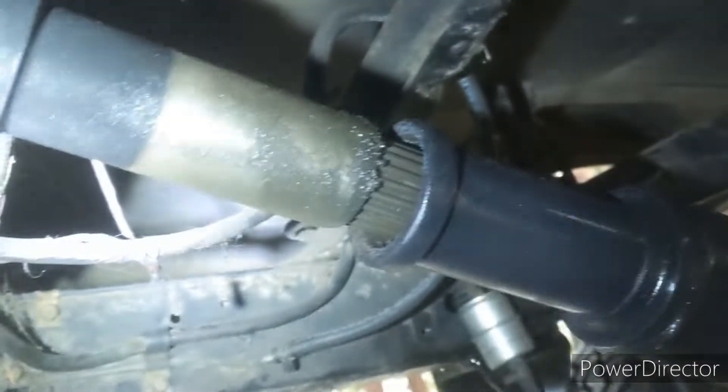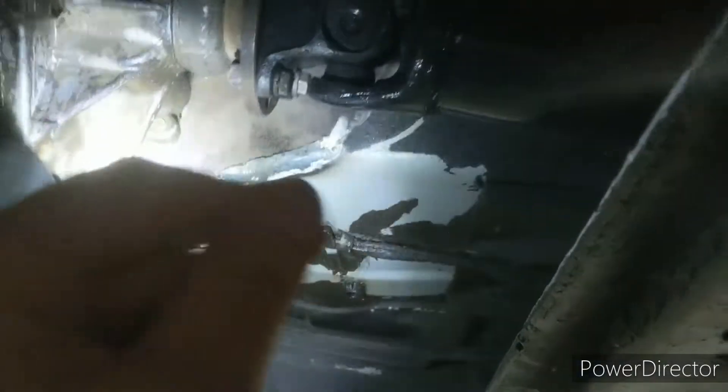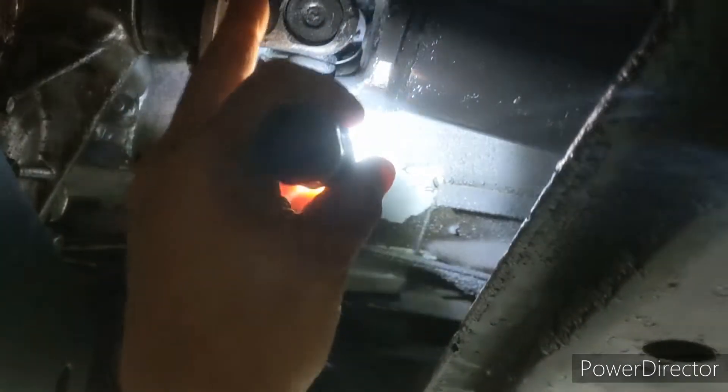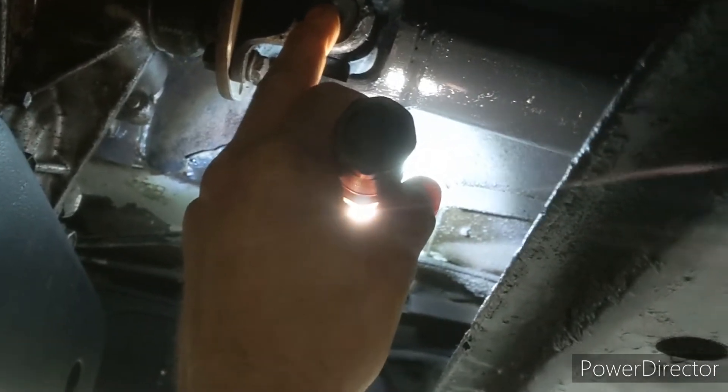Let's talk rear driveline. You can see it's just barely hanging on — this is the mocked-up version, proof of concept. My idea was to use a stock rear driveline and shorten the first piece, which I did. I triple-drilled the flange on the diff to accept all the patterns, so this is the two-wheel-drive pattern right now. When I have this cut and laser-balanced professionally at my South Bay driveline shop, I'm going to have them put the standard late-model four-wheel-drive yoke on here with the slightly bigger U-joint. I've got little mock-up spacers here to keep this short shaft in line with the transmission — it's at a slight angle now. This is all mock-up for a test drive and test flex in the next video.